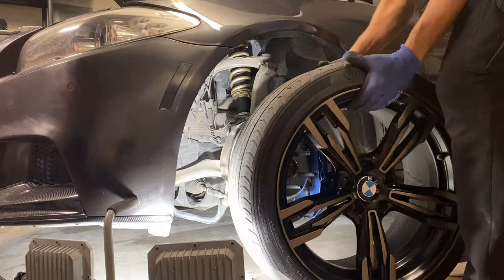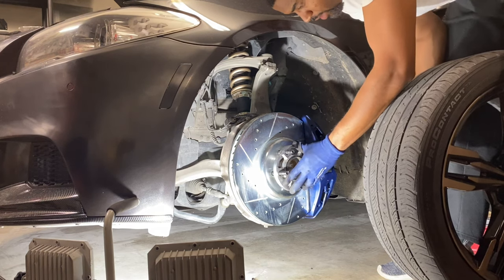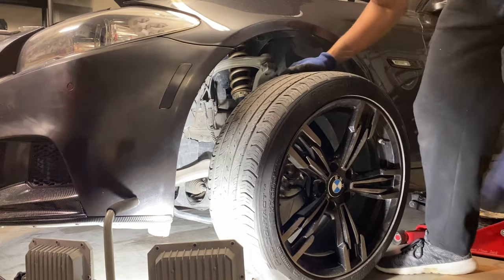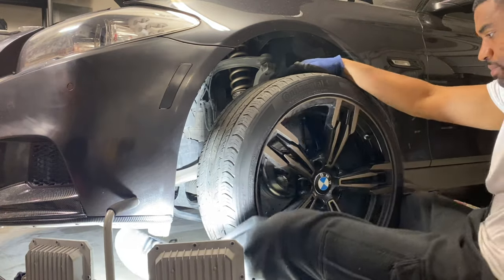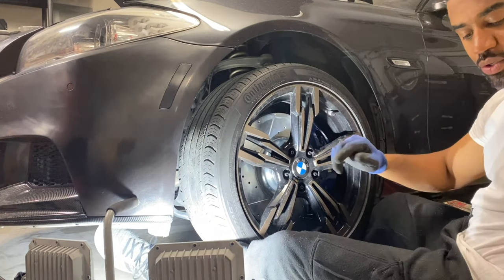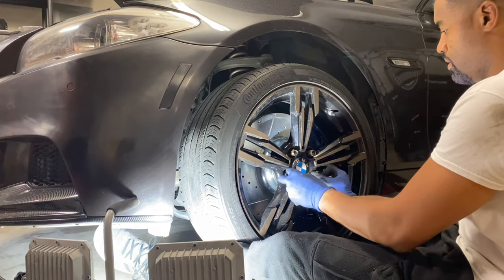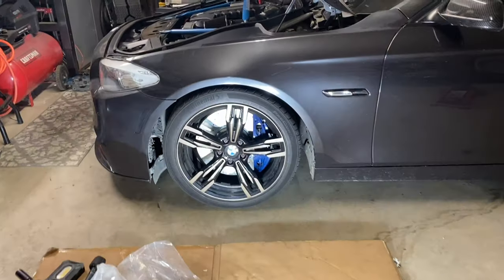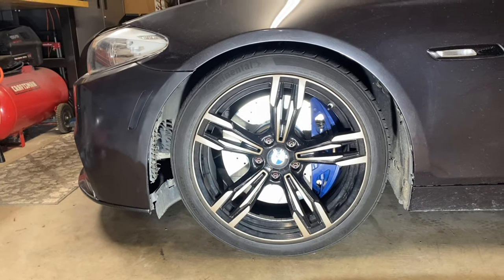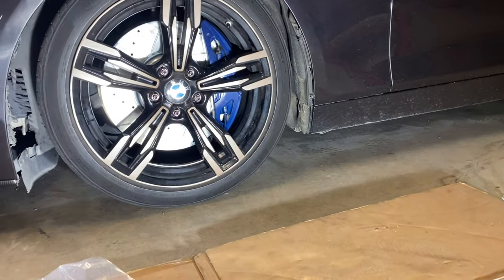All wrapped up — time to mount our tire. We're going to throw our wheel spacer back on. I'm running 12 millimeter spacers in the front. I haven't tried fitting these without the spacers but I wouldn't want to run them without. There's our finished look — I've got a hole from something that came loose and ate up my inner fender, so I'll have to have that replaced, but those calipers and the new rotors look awesome.